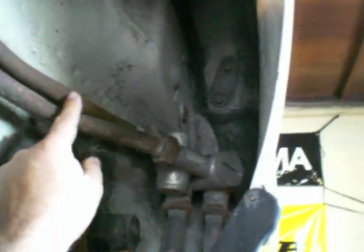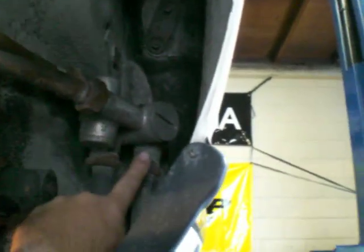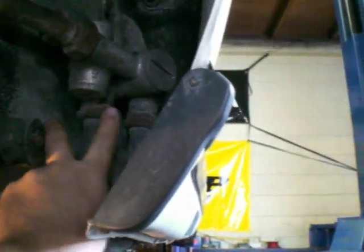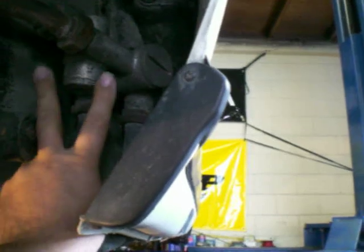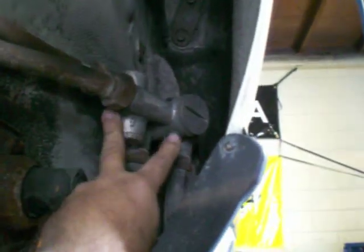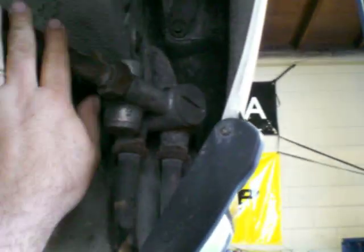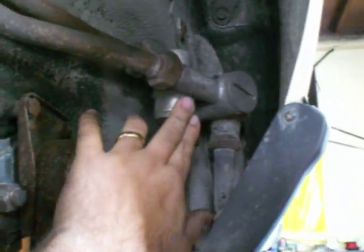We come right here to the oil thermostat — check this for leaks. One word of warning: when you try to pull these off with this much corrosion, it usually pulls the metal threads — pulls the aluminum threads right out. So we're going to try to heat this and get these off gently to not damage this. But these two lines are junk anyway — we know they're leaking. We're going to try to save these lines and save this thermostat mainly.